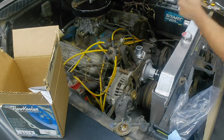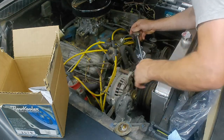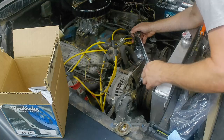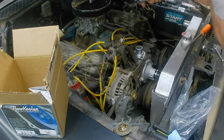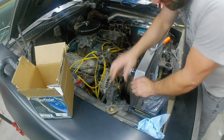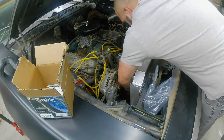And much like the water pump, I believe the torque spec for this is 30 foot-pounds. A little harder because we're limited on space. I got that torqued to 30 pounds off camera — I couldn't find my extension — but either way, we're back together. Hopefully we'll have no leaks.